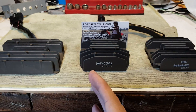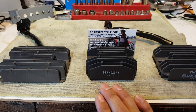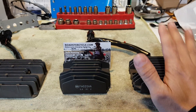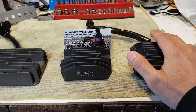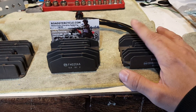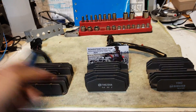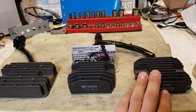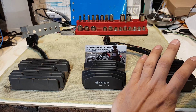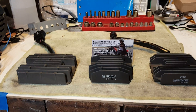That's why I'm moving into the MOSFET arena — I'm looking for longevity and a better way of doing things. These things get really hot, and the stock location on the rear left side of the motorcycle underneath the rear fairing gets very poor airflow. So on my motorcycle I went ahead and relocated mine to the front of the bike where it receives the most cool air, and I haven't had any issues with wires frying since that modification.